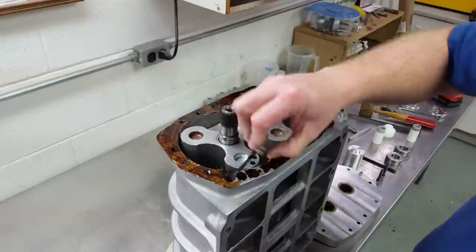When you're machining the backs of the drive gears in order to change rotor clearance, there's a ratio of three to one — if you take three-thousandths off of the drive gear, you end up tightening rotor clearance by about one-thousandth of an inch. After pressing the gears back onto the rotor shafts, I rechecked clearance. I came out with eight-thousandths of clearance between the two rotors — that's the dimension that I wanted, so I'm going to leave it assembled just like it is.